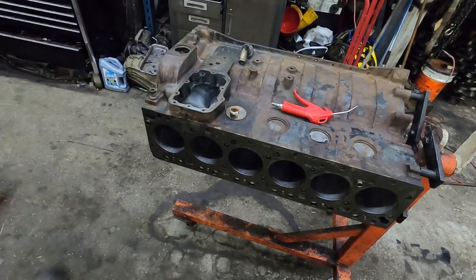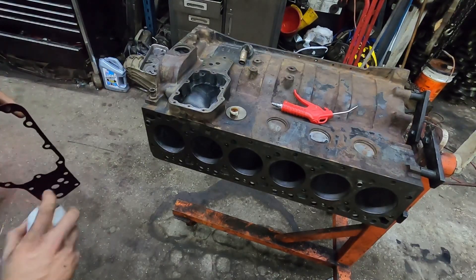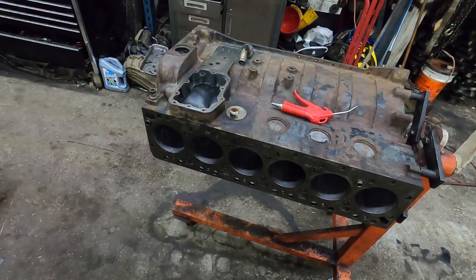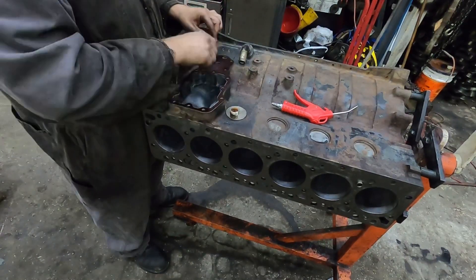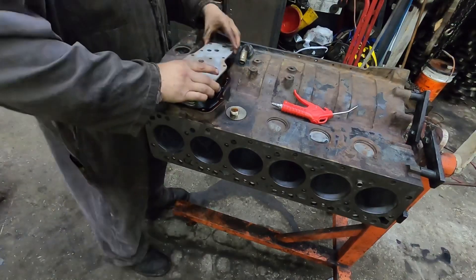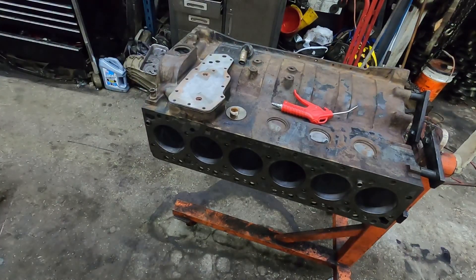What I've done is coat the gaskets - these came with the oil cooler kit. I put a little bit of high-tack on them; there are all kinds of different brands, basically a spray gasket tack. I find that helps the system seal better and the gasket stays in place. I recommend replacing the oil cooler anytime you're rebuilding an engine, regardless of what kind of engine it is. I high-tack a couple little spots and make sure none are missed.